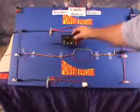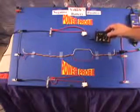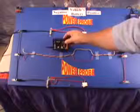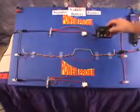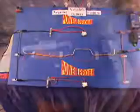I like to gauge the reception distance often so I know we're on the right circuit. So if I come across another wire that requires me to get closer than 4 inches before the signal detection, I know instantly that it's a weak signal and I need to avoid following this wire. We need to stay on the wire that detects the signal about 4 inches away.